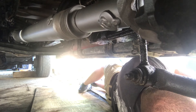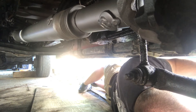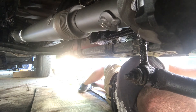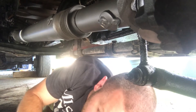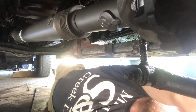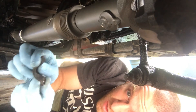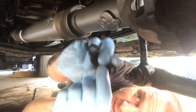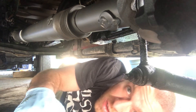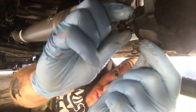Mine are a little worn out, so I absolutely have to use a 6-sided ratchet or a 6-sided socket. When I took it off that day at the store, someone tried to give me a 12-sided socket and it wouldn't turn them. I started second-guessing that it was 8mm, convincing myself it was some odd size because I couldn't get a 7 or an 8 to fit. Anyway, there's just this little U-clamp and the bolts — the U-clamp goes either side of the U-joint.